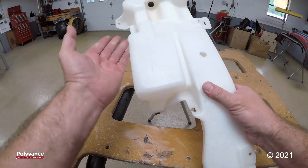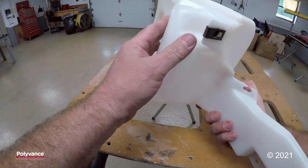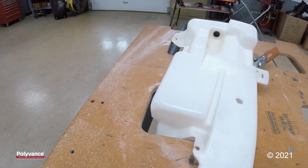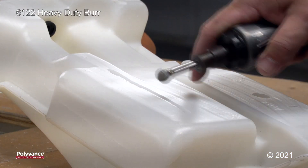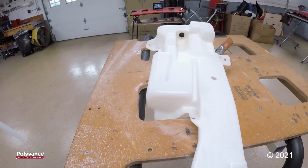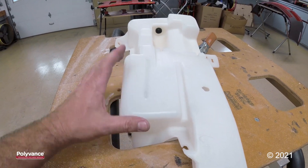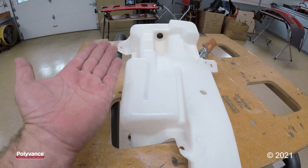With a crack that I could get to the back side of, I would apply aluminum tape to the repair. But since we can't get to the back side of this crack, we are going to have to make sure that we do not overheat the plastic and cause it to collapse. With your typical repair, if I had tape on the back, I would V-groove deep on the front side. This is the incorrect way to repair a reservoir tank — I V-grooved the plastic deep on the front side, which is something you do not want to do.